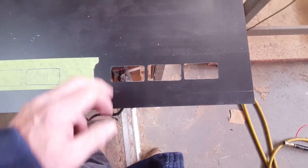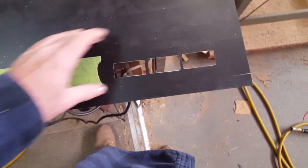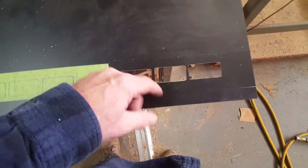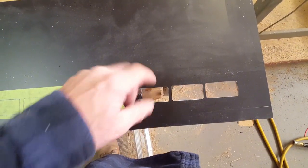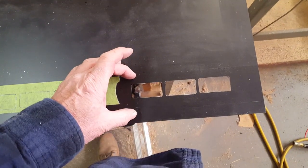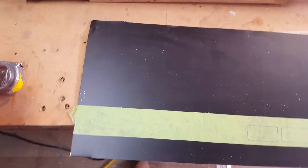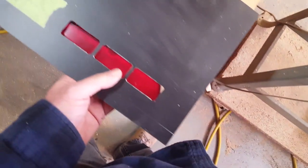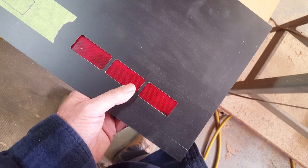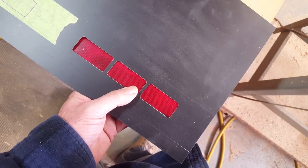Anyway, this is the result, and I always try to give myself a lot of beef around the edges because these are small profiles, to keep it from tearing out. Then I'll go back and cut this out on a shear to the finished size to reflect what I have here. So I just thought I'd show you that while I'm developing these. This is a little bit longer, and this, like I said, is for this lens here, and will fit up underneath here like that. Of course, I'll have to paint these because you see the aluminum edges. Anyway, just another detail.